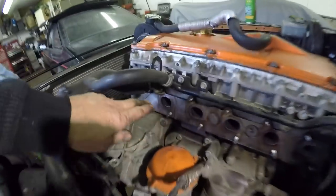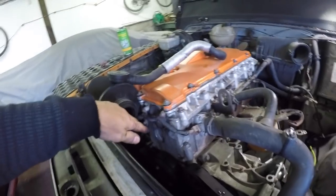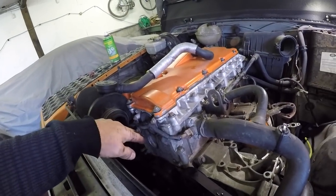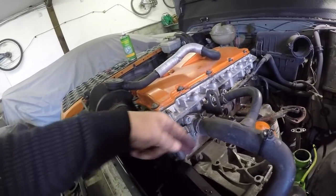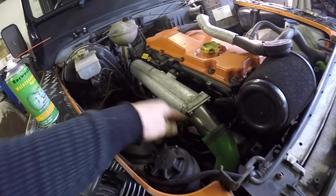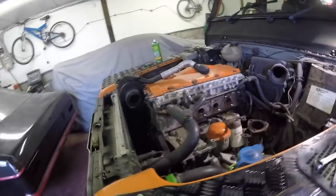So that usually goes to the front of the manifold and round the front of the engine to the EGR cooler. So you'll have an EGR cooler on a 15p. On a 10p, it'll just be a pipe going to the EGR valve. Obviously I've got a blanking kit on this one, so I've just got a pipe there, but normally you have your EGR valve there. Absolutely useless. Take it off, throw it in the bin.